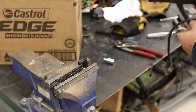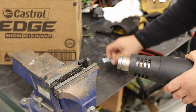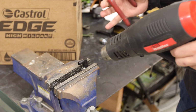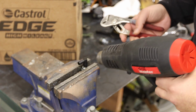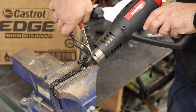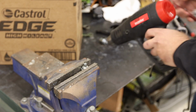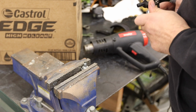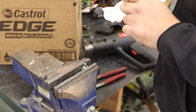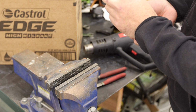One of the challenges with this is that the fixed orifice PCV valve, none of them come with the 90, but it's basically the same fitting as a regular PCV valve. So you just need to heat this up and then pop it off. Okay, it's on. All right, perfect. Switch over complete, and actually it gives you a nice shot into that pintle valve.